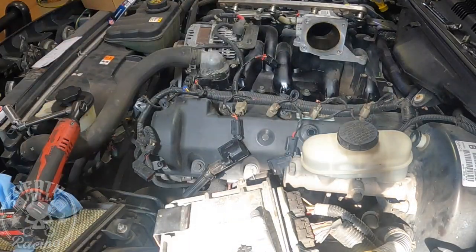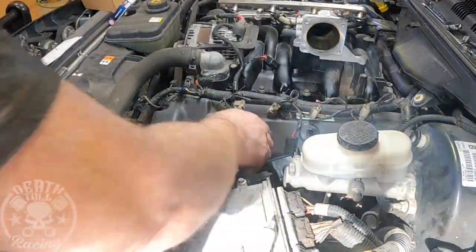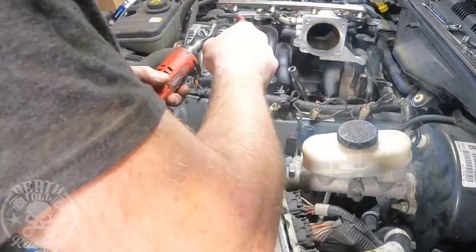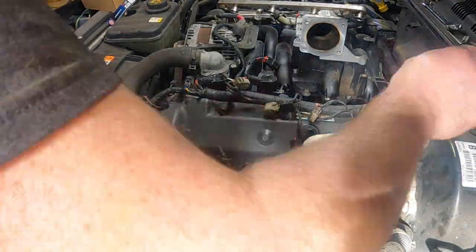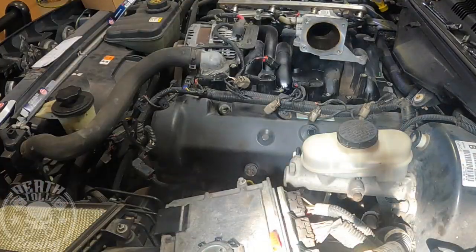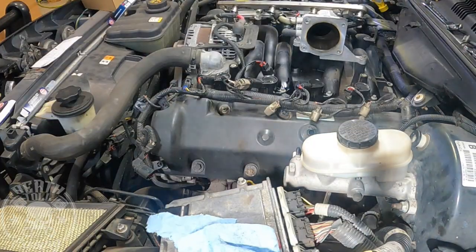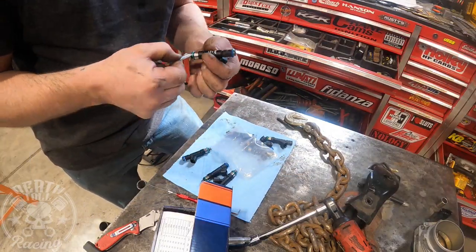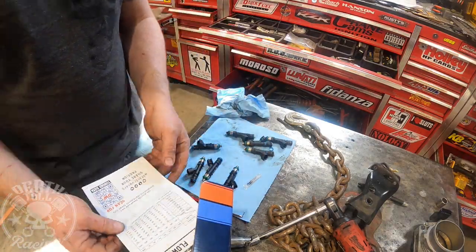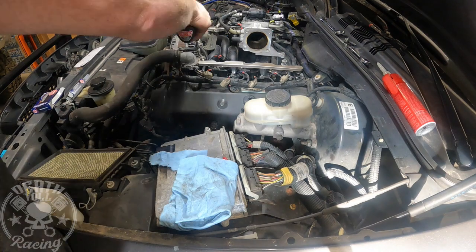The coil I just wiped off had water in it, so I need to do a better job putting dielectric grease around the boot as I install it so water won't make its way down in there. I'm gapping my plugs at 44, which is basically factory. I'm not sure if I should go up or down on gap with the turbo setup, so I'm leaving them at 44 for now. I'm replacing the plugs with a colder plug — started as an NGK 55 (5.5 heat range) and we're putting in an NGK 7, which is about one and a half steps colder. The higher the number on NGK, the colder they are. We're using iridium plugs; part numbers will be in the description.